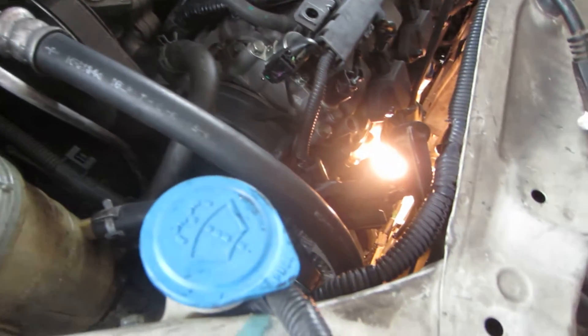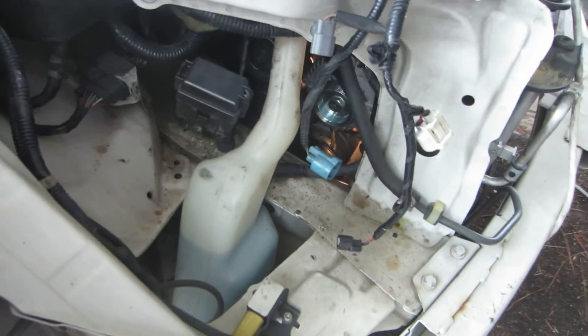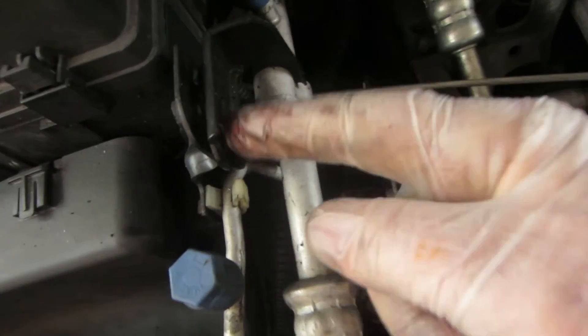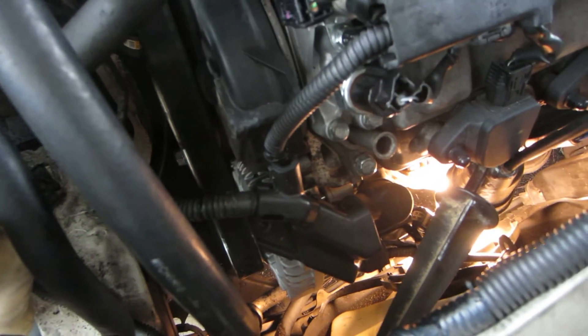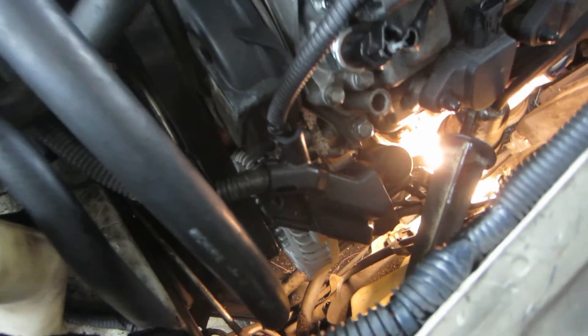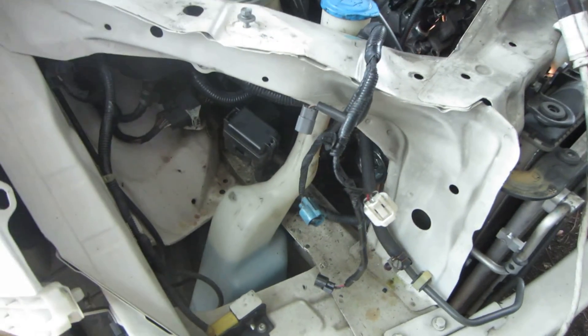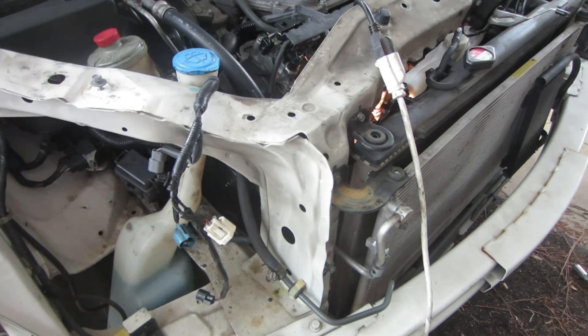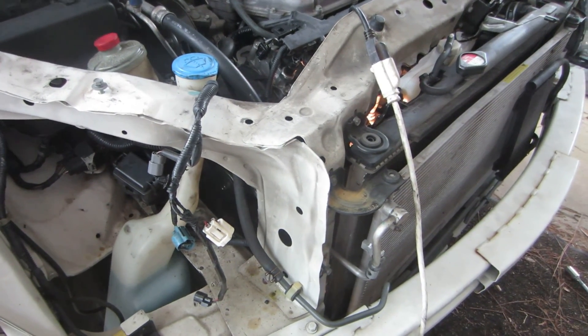The new alternator body went in very easily, and I think one of the reasons is I had a lot of room to access it with the headlight removed. You can work the alternator in from the top — I've seen other videos where they've done it that way. One other video showed loosening the AC compressor bolts; I wanted to avoid that, and having this kind of access gave me that advantage. Thanks for watching — I'll post these in sections covering the different steps. Have a great day.